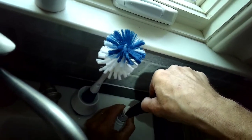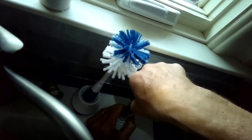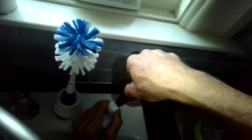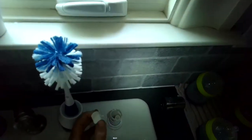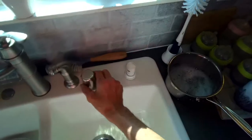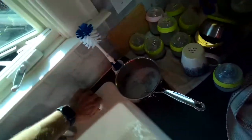Maybe a little fish bone with some other material wrapped around it that's causing a clog in the drain system. The dishwasher motor works to get rid of the water but it can't leave because it gets stuck in that tube. So if you look in there and you don't see any clog at all, the next thing you could think of is trying to disconnect the dishwasher drain hose below the air gap.